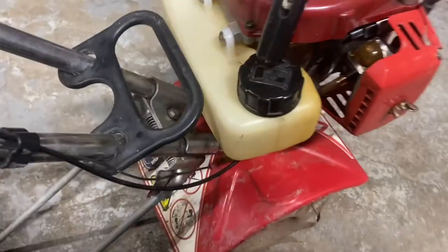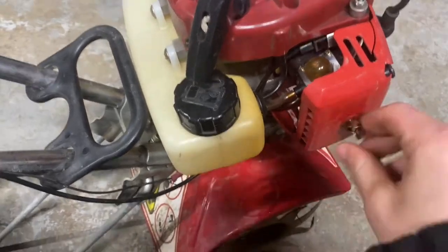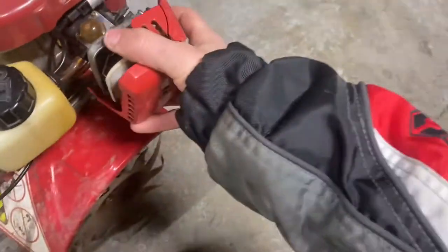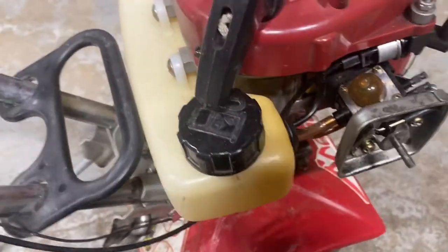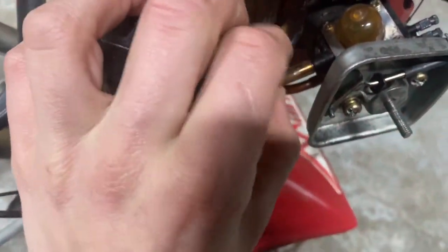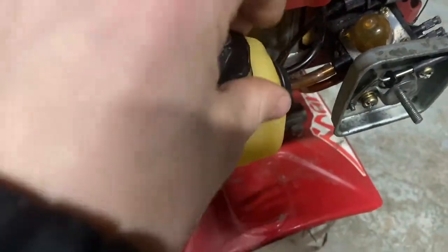The first thing we have to do is take this cover off. I got a paper towel for the parts. The kickstand is not the best either. That air filter is pretty dirty — we should probably replace or clean it out. Taking this stuff off gives us more access to the fuel lines. Let's just disconnect — look how solid these hoses are, no wonder it didn't fire.